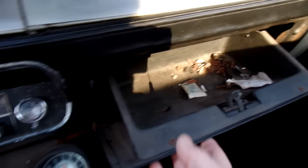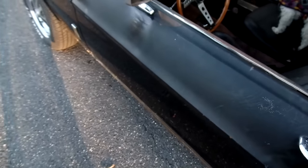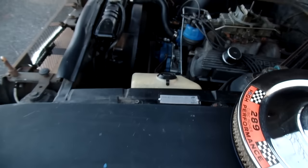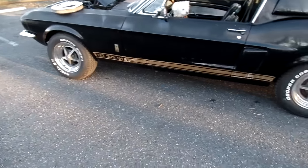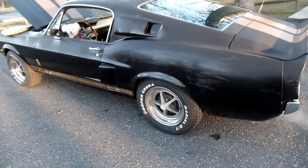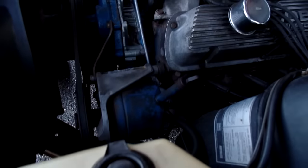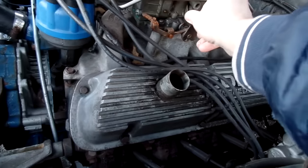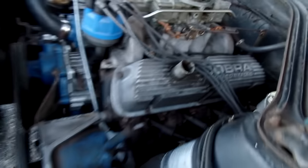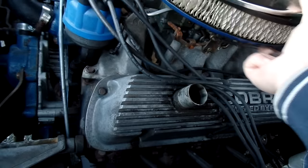I don't have an owner's manual — I wish I did. If you're looking for a car that's original and needs to be restored, this is the car. I don't think you need to rebuild that motor. When I took the timing chain cover off it had the hatchet on the front of the crank — the hatchet is on there to offset the weight of the rods; they're heavier rods on a hypo. So I think it'll run a long time. No smoke — I haven't seen a puff of smoke from it. The exhaust smells good. I don't see any blow-by. You always want to check for excessive blow-by. I don't see nothing. Of course I don't have the PCV unhooked, but if it had excessive blow-by it would be coming out even with the PCV.